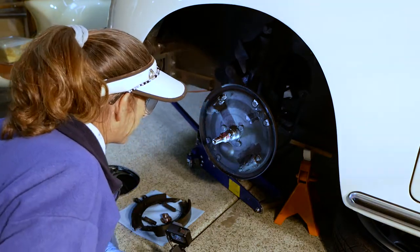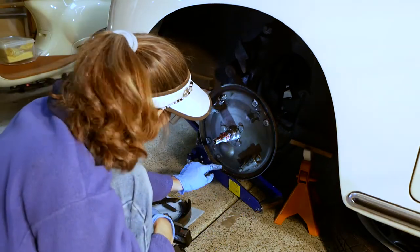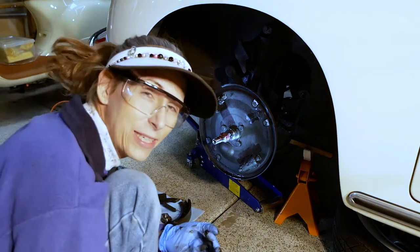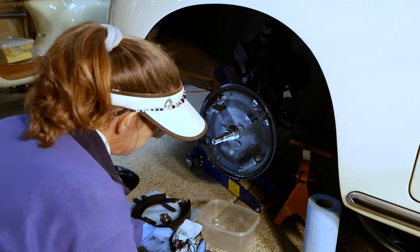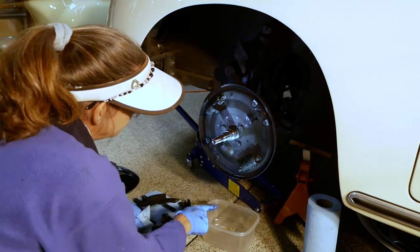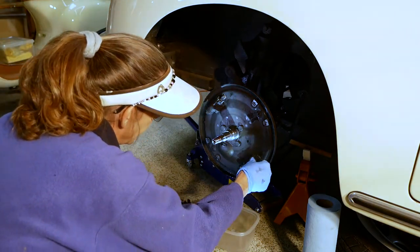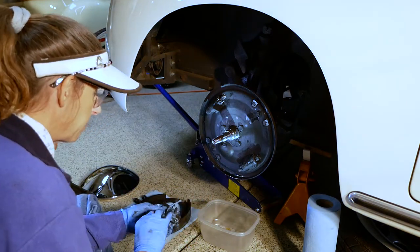Yeah, this is all a big old mess. I'm gonna go ahead and start with a little cleaning. I'm gonna get something to put underneath this. Boy, look at this, we have standing goo in here. Isn't this something? That's just terrible. And I hate to say it, but I think it might be brake fluid. If the rear seal was gone, I'd probably see a lot of schmutz right around here. What I'm seeing is a tremendous amount down here, which is this guy. It's gotta be. This just looks bad. So I think I've got a leaky wheel cylinder. I think I'll definitely be rebuilding that.